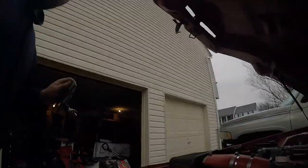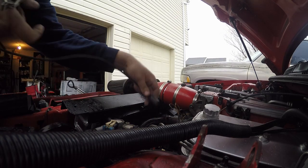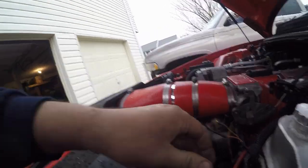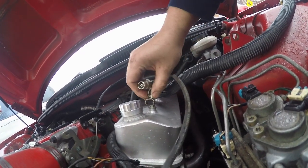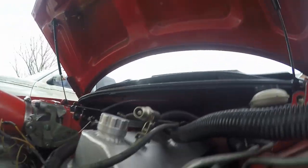Well, that wasn't what I was expecting. I heard the fuel pump come on and I smell fuel, so I think my injectors are firing. I'm going to put a wire on my coil pack. I've got my little spark tester here — I'll connect it to ground right here and we'll check if we have any spark.